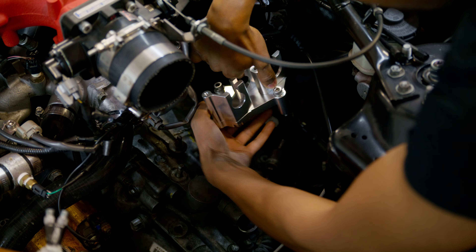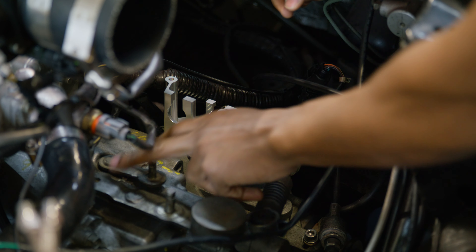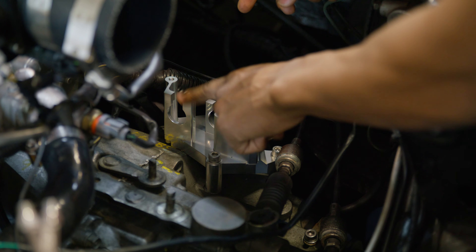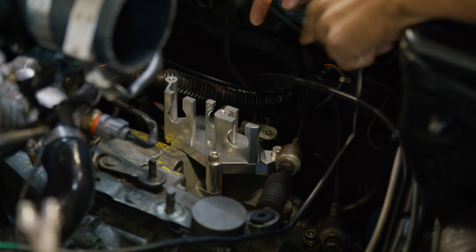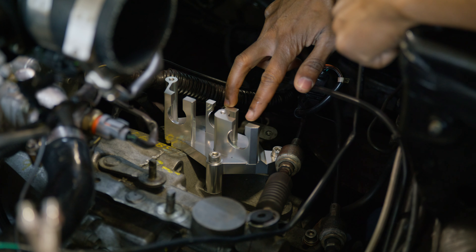The next step is to put our shifter cables back in. The small cable on this particular transmission is going to go on the center. Now, a transmission only has two shifting points — one for left and right, and one for forward and backwards. Our bracket has three, and the reason we have three is because across the J-Series transmissions, Honda actually uses this spot, this spot, or on some they use a third spot all the way over here. In my case, I actually put on the third bracket for the video, but for my car I don't need to use it, so I can leave that piece off entirely, because I'm only going to be using these two.